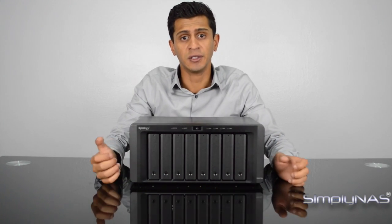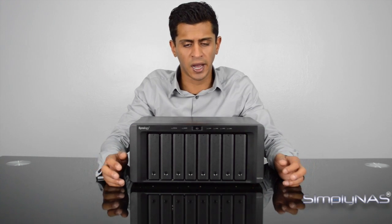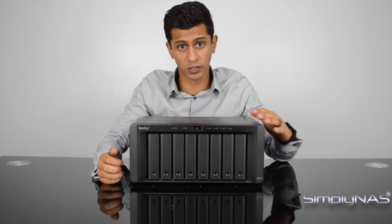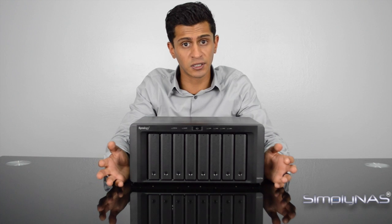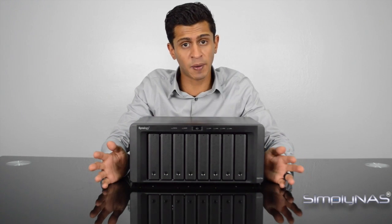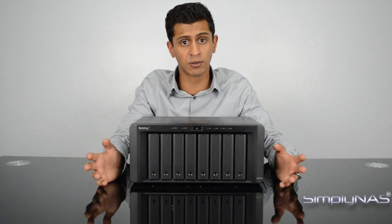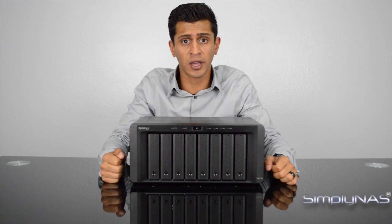SSD cache allows you to install an SSD — the largest available is about a terabyte, but that's overkill for cache; we don't recommend going higher than 256GB. With 256GB SSD cache it sits on top of your RAID and boosts performance, acting like additional RAM. When adding SSD cache, make sure you upgrade your RAM to 8GB from the 4GB stock configuration, as that's necessary. DSM comes pre-installed on this NAS — it's an award-winning, easy-to-use and intuitive operating system. If you've used a smartphone, you're already used to it. This unit is backed by a five-year warranty from Synology, though it doesn't cover water damage, so make sure you insure the unit if that's relevant to your environment.